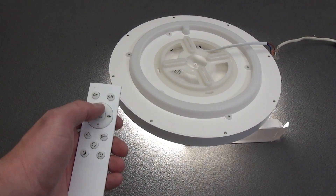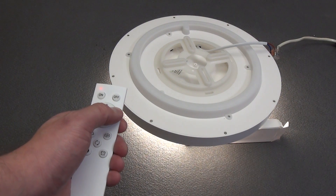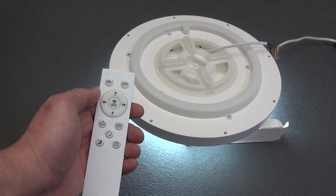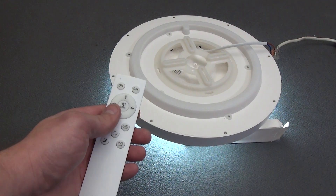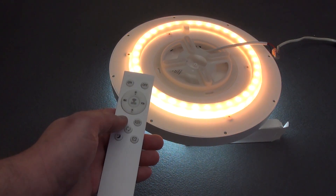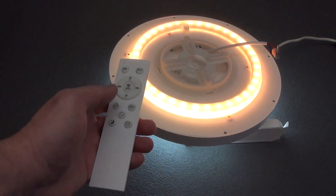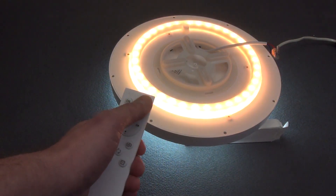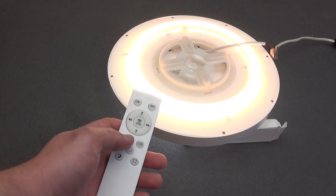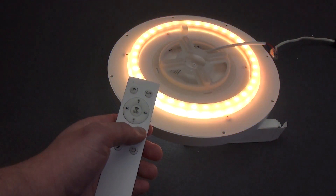The main element for setting up the lighting is the central circle. Pressing up increases the brightness, pressing down decreases it. Pressing left or right changes the color temperature of the lighting. Pressing and holding the central button called Setup for more than 5 seconds puts the lamp into pairing mode for connecting to the smart home ecosystem. There are 5 additional buttons at the bottom. The button with a triangle and the inscription RGB turns on or off the circular color backlight, and there is memory for the set color. You can also cyclically switch programmed backlight colors and select smooth or fast color change modes.